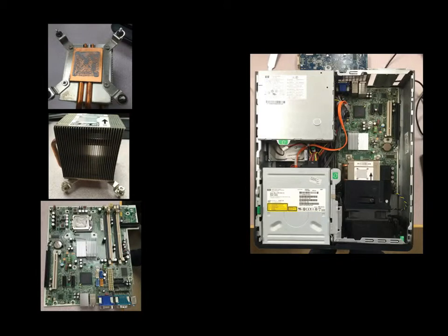Now that the motherboard is installed in the computer box, next thing is going to be installing the heatsink. The heatsink actually allows for cool air to blow through the aluminum grates that are here, and that is actually expelling heat from the processor. So like I told you guys before, the 4 screw holes that are around the processor right here are for these screws on the bottom of the heatsink.